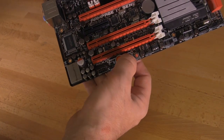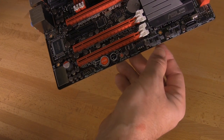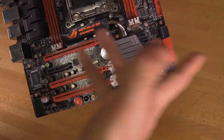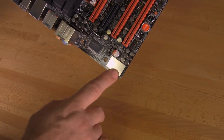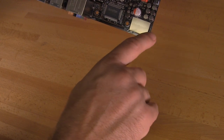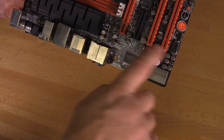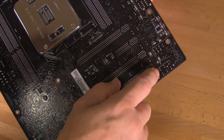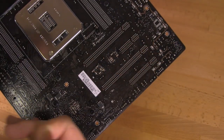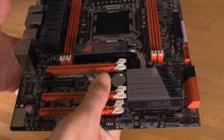Taking a look at the bottom of the board, you see they have their nice controls. You also have your go button, SPDIF out, and a couple of USB port headers down here. There's a SATA port here usually used for eSATA functions — so if you have a case with an eSATA header on the front panel, that's what you're going to use that for. You have your Supreme FX3 chip with something of an EMI shield over it. As we've talked about on all their newer Republic of Gamers lines, you have this separation — all of the audio controls are actually separated from the PCB. They're broken out and there is an LED in here to show you that physical separation, and you can even see it on the back — there's a single connection through but for the most part it's almost entirely segregated, lowering feedback and electrical interference with the audio for better audio performance.